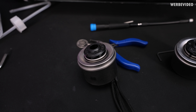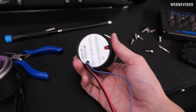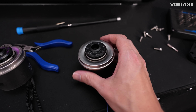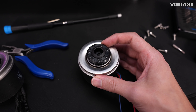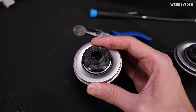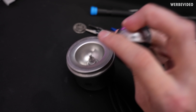I kind of have to walk back what I just said. That is our replacement pump — it's a D5 which was meant for a completely different project with an external Mora. That's also why it's not PWM controlled and doesn't have the nice sleeving, but it's a replacement pump and as long as my PC will work again I'm totally fine with that. Can always replace it later and sleeve the cables if required. If I gently touch this, it is so easy to rotate. It is much harder to rotate this pump and I'm not sure why.